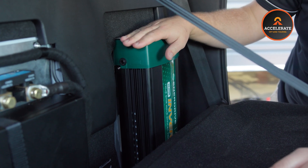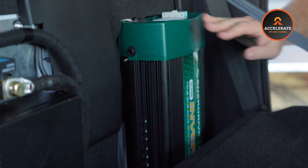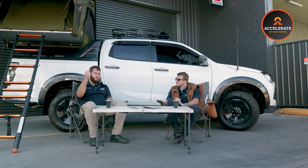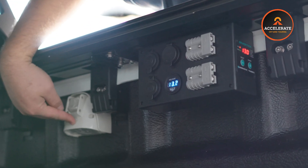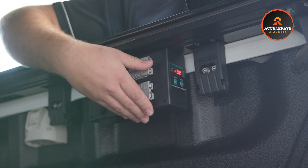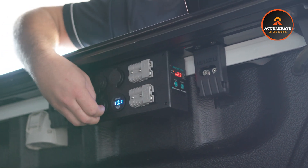The reason we've gone 200 amps is to cater for a large inverter. The inverter is mounted behind the back seat — on the D-Max you can just pull the strap down to access it, but you don't want to have to dig through gear while travelling. So in the tray, we've installed a weatherproof 240 volt outlet, and the switch for the inverter is also on the socket panel in the back. Super easy — when they're at the back of the car, they get their induction cooker out, hit a button, flick the 240 volt GPO on, and away they go.